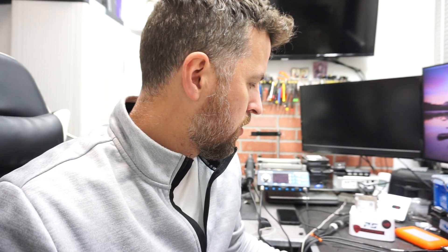The instructions might be slightly different for the larger models — I'm talking about the 17-inch ones — where you have a couple more things you'll have to open up before you can reach the hard drive, but theoretically the instructions are pretty much the same. So what we're going to do: I'm going to change the internal drive of the MacBook Pro with a solid state drive, and I'm going to add a secondary hard drive into the machine, which will give the customer more storage.